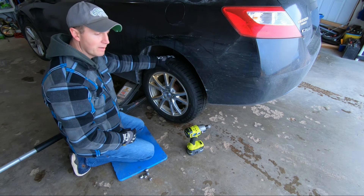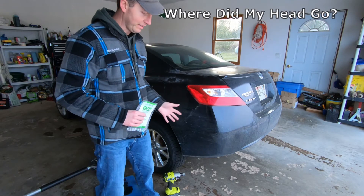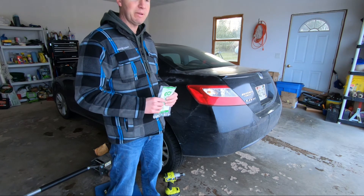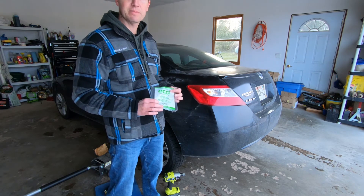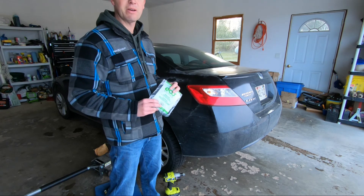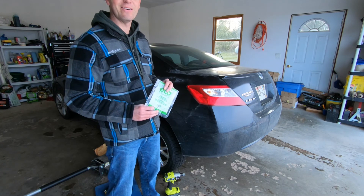Once you have your winter tire mounted, make sure you go around and check all the lug nuts and torque them to the specs of your vehicle. If you're tired of driving in the winter months and getting that snow and ice built up in your rims — driving down the road and it's shaking and vibrating, and you've got to pull off to the side, maybe get out your ice scraper and chisel that ice away — I recommend trying these tire balancing beads. There are many different brands out there; I went with the Eco Balance and they worked really well, probably one of the best for the price. I'll leave a link in the description where you can find these balancing beads. Thanks for watching, and remember to get outdoors with Dino.